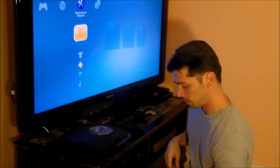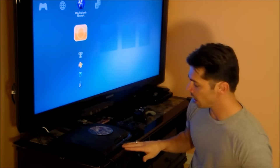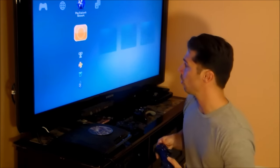The most common fix is an overheated PlayStation 3. If you've got a lot of dust in the vents clogging them, the fan can't blow out the hot air, and it'll overheat and turn off or lock up.